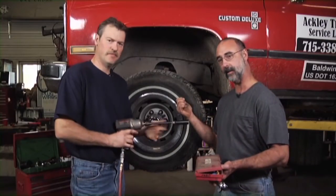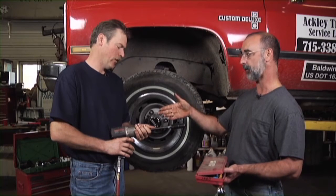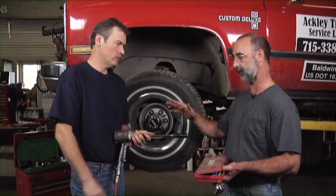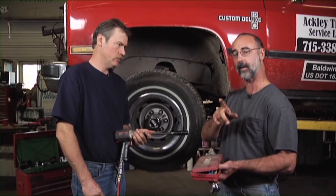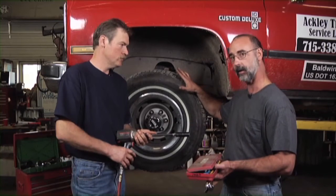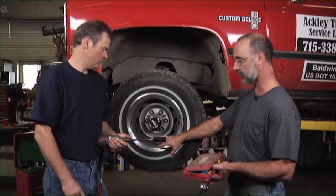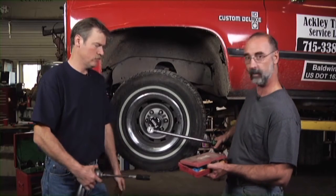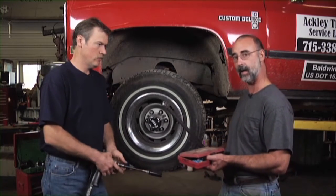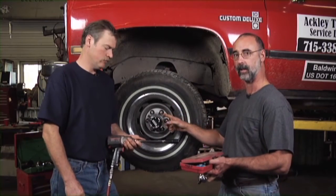When you're ready to get wheels back on your vehicle, it's really important that you get the lug nuts torqued just right. An impact wrench is an okay tool for this if you've got an extra component to go with it. What we could do is get the vehicle on the ground so that the wheel is back on the concrete, and use a torque wrench to make sure we've got each of those lugs tightened the right amount and a consistent amount. It's really important that every one of those lugs is tightened the same.